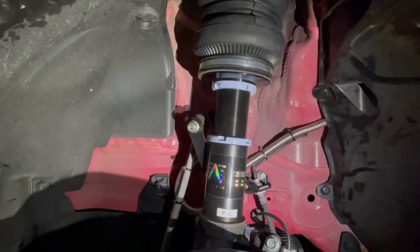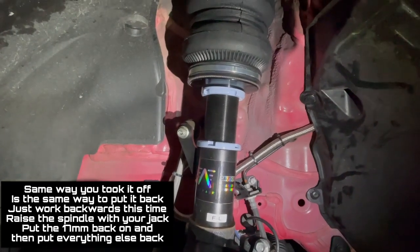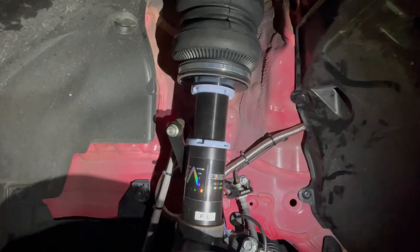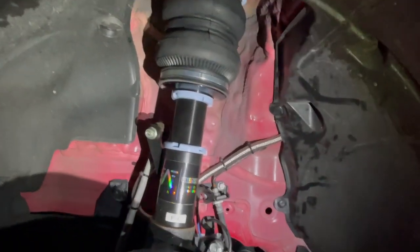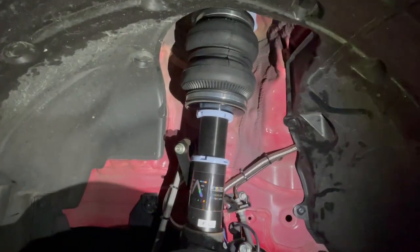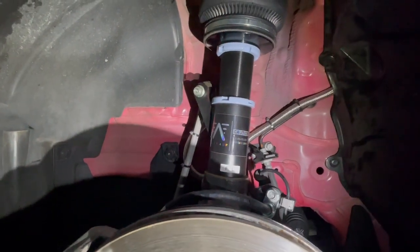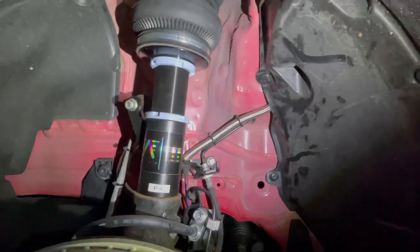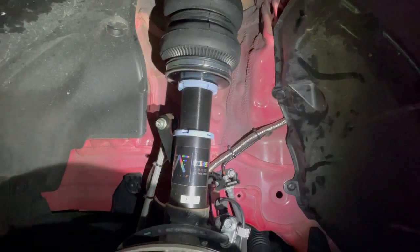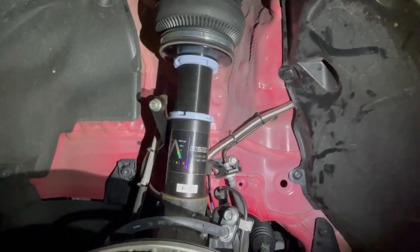And this is how it will look installed. Well, for bags at least. If you're not doing bags, it's practically the same thing for coilovers, if you've installed coilovers before. But check it out. These air suspensions come with these stainless steel lines. I zip tied a small portion into the end link. Since I ran the airline through the grommet in here, I made sure it's all nice and tucked where nothing will touch it. But I know for a fact this will work out perfectly.